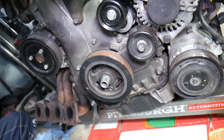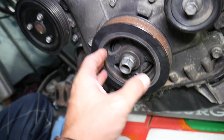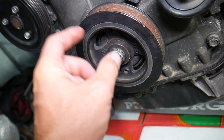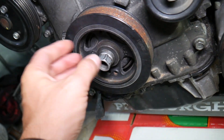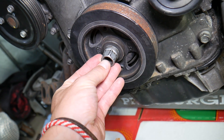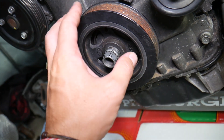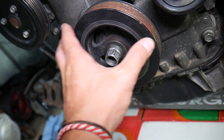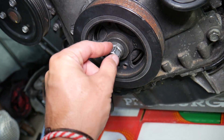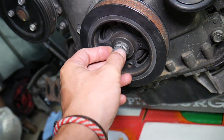Right here is where things get a little interesting. This crankshaft pulley is actually keyed — you can only install it in one position. Some modern cars don't have a key, and once you remove that bolt the timing will be completely off, you can bend valves, and you'd need to rebuild the engine unless you use proper timing tools. On this specific 2.4 GDI — a 2013 — we can go ahead and remove the crankshaft bolt.